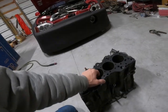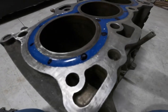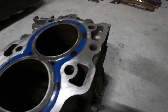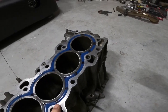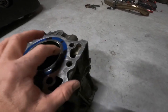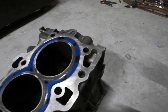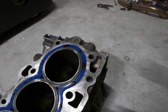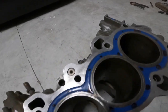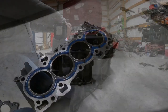Let's see what it looks like when we get this thing marked out. As you can see, you've got all the markings here. The biggest thing is you never want to get too close to the edge — you've got to be dead center. Where the larger water pads are, I'll drill two holes side by side where they barely touch, to try to get the same water flow as the head gasket. Let me get a drill bit together and we'll come back and drill this guy out.